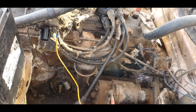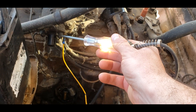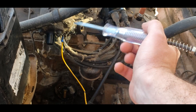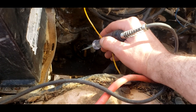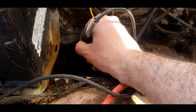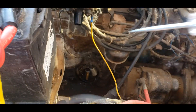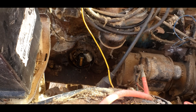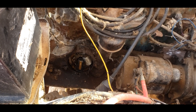So what I've done so far is verified that we have electricity going to the coil. I did ohm out the coil and it's decent — I probably need to replace it. Down at the points we have power there as well, but I don't really get any spark from it, so it looks like the points are really dirty. I found my points burnisher — I want to see if I can clean them up a little bit, check the gap, and see if I can get spark.